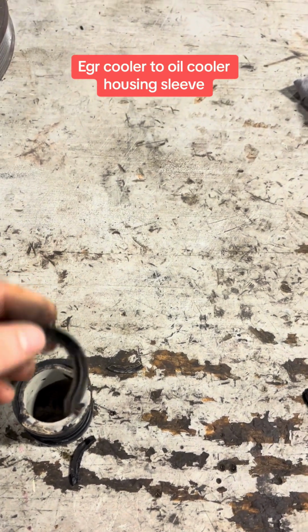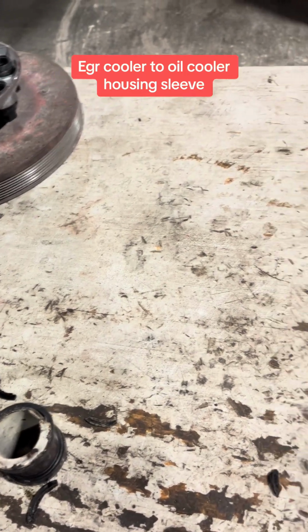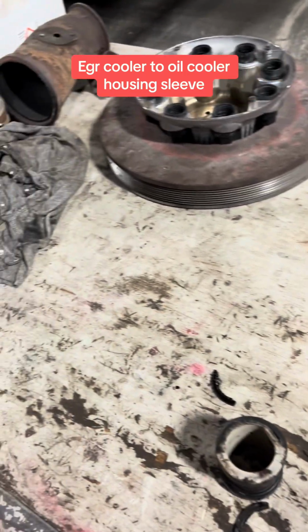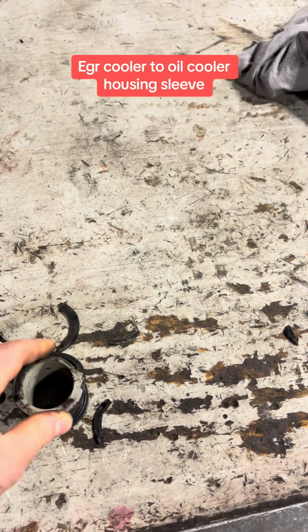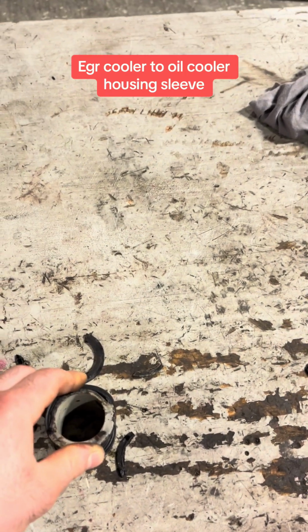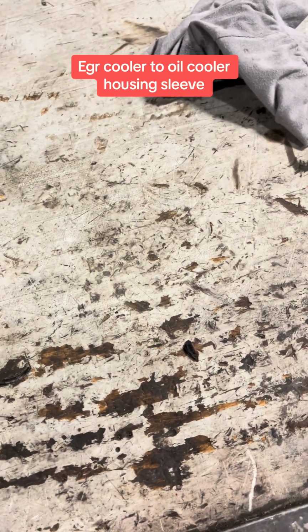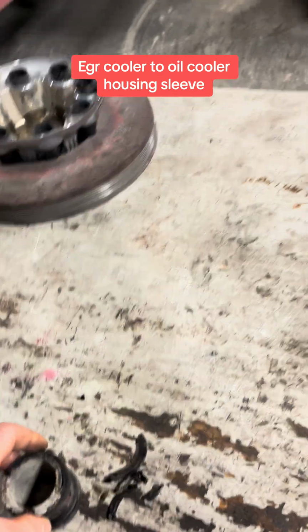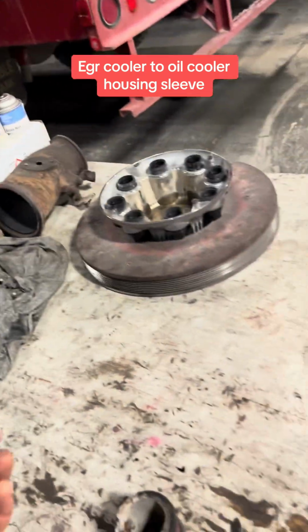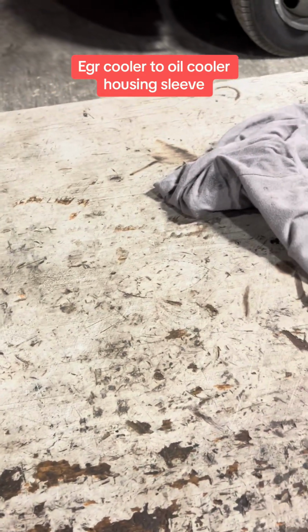There'll be a couple of pieces in your EGR cooler for sure, and those aren't too bad. You can tilt it and get it out, because when you tilt it, the coolant comes out anyway. That's another thing. Be careful when you take this off. Be ready to catch a lot of coolant, because that EGR cooler holds quite a bit. Get those out, and then on the oil cooler side, just be careful. If there's any pieces there, try to grab them before they fall inside, because once they're in there, you're not going to take that thing apart, I'll tell you right now. But like I said, the EGR cooler, it'll pretty much come out when you tilt it, or else you can get in there with a pick or something, because it's got tubes in it, right? You know how the EGR cooler works. It's got the tubes, so the pieces ain't going to pass that. So for that much, you're okay.